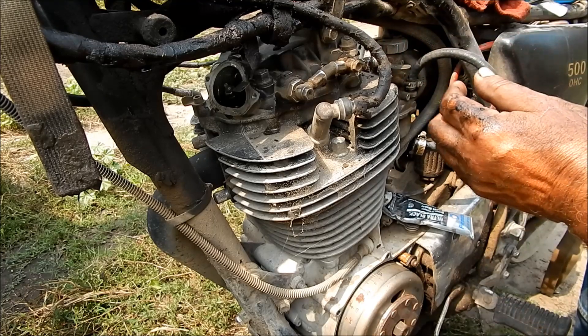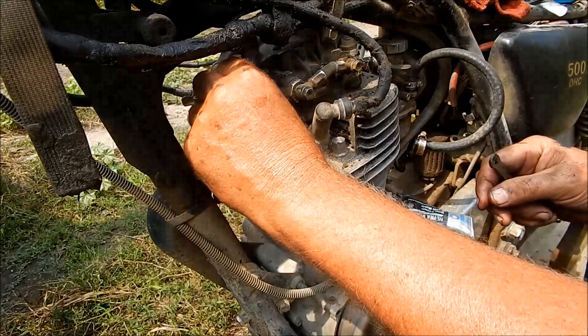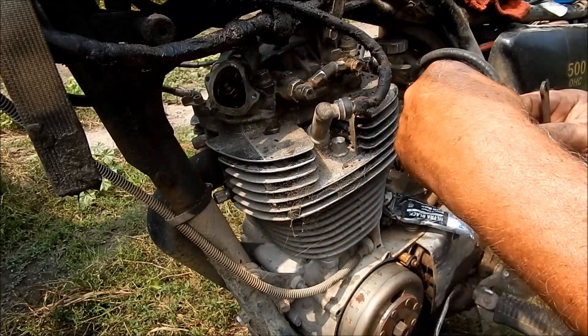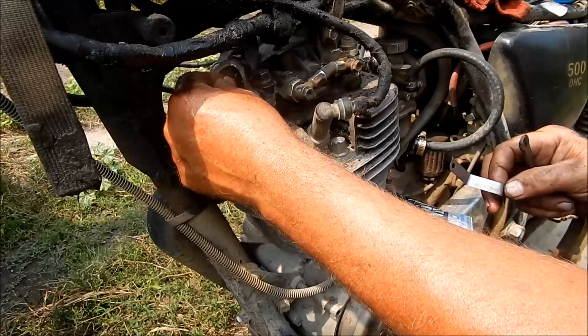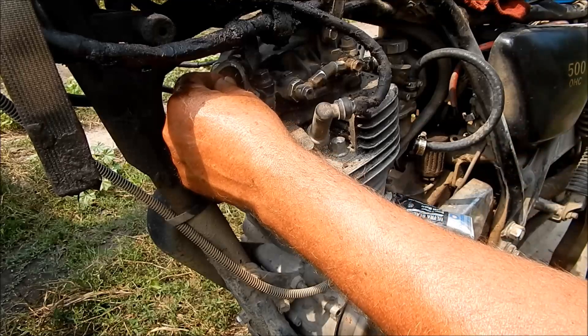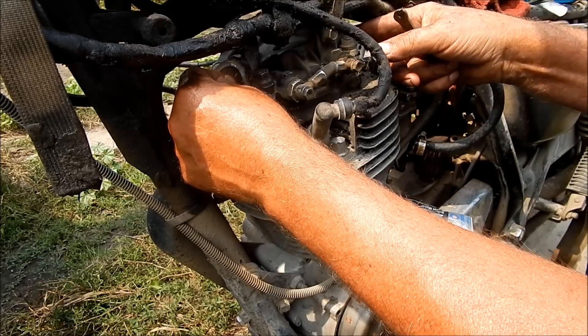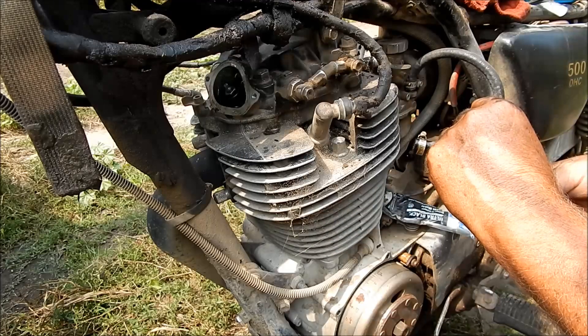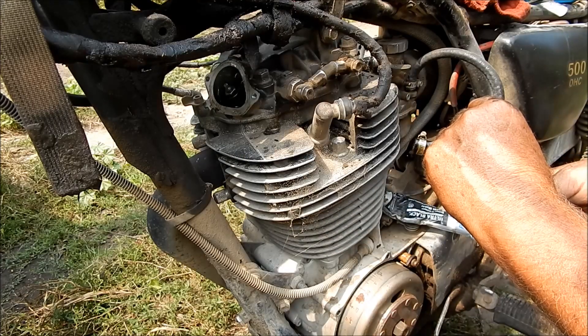I know that's just right at five, and I've checked it with the gauge. See, a little deeper clunk — that's a seven. Five, seven. So I know I got them, but it's one of those things you got to check, or you risk burning out a valve.